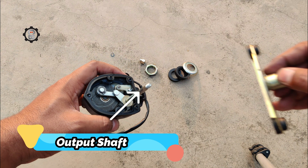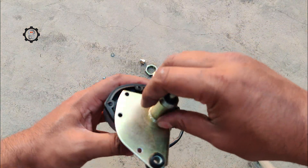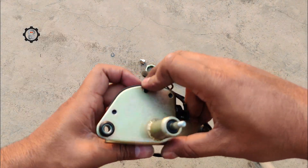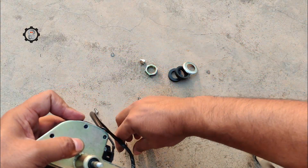Output shaft: the output shaft is attached to the gear mechanism. It helps transmit the wiper motor gear rotation to the outside, thereby helping to move the wiper transmission linkage. In a rear or back wiper motor, the shaft drives the wiping blade directly.